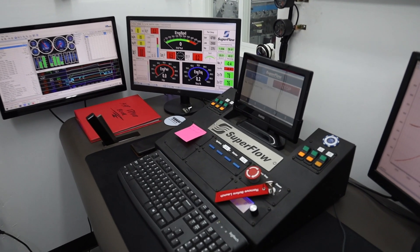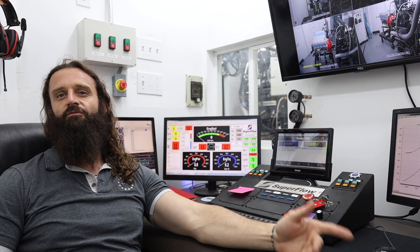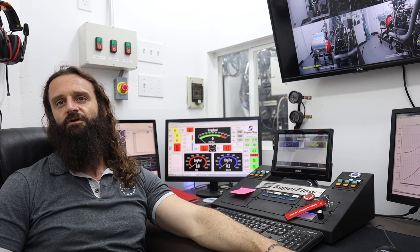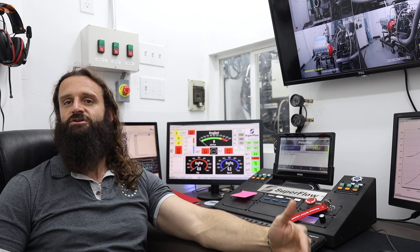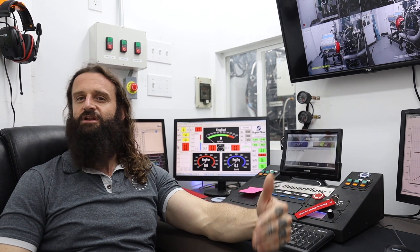My name is Coley Heimlich, I'm the owner of American Heritage Performance. We recently conducted a camshaft lift test here on our in-house SuperFlow SF902 dyno, and I wanted to recap a couple of things about it. The engine for the build is one of our HP 442 LS7s that we build quite a few of. The original camshaft we had in this engine was a mild duration but high lift camshaft. The customer's request was basically a stock-like drivability camshaft for a 442 displacement, but he wanted a lot of lift to take advantage of the Archangel heads. So we set him up with about a 680–686 lift camshaft.